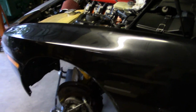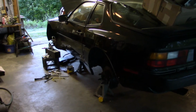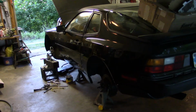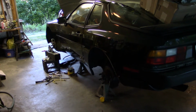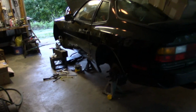You don't really get a lot of air out of it, but it's tough to do by yourself, because really the way you have to do it is push down on the brake pedal and then open the brake bleeder, and then before the pedal comes back up again you have to close the bleeder. So if you don't close it, it can suck air in when you bring it back up.